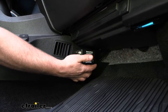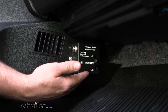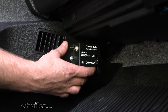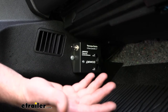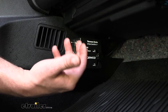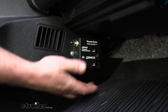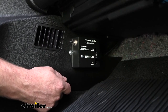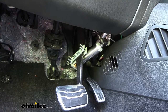Even if you want to make small adjustments, it's super easy — that's what this knob is for. You can adjust the sensitivity: if your car isn't braking as aggressively as you'd like, turn the knob to more sensitive. If it's coming on too hard, turn it to less sensitive. With a small car you can usually get away with less sensitivity since the motorhome can cover a lot of it. But with a big heavy truck, you can make it more sensitive so it comes on a little stronger.